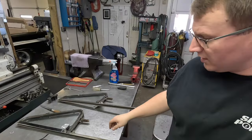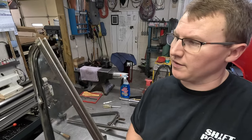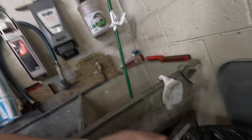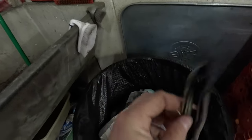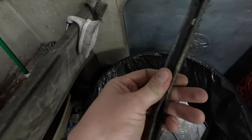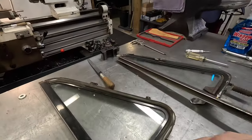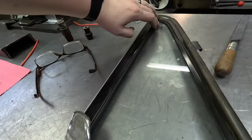We've got the vent windows over here. These channels had some felt weather stripping left in them — pretty sure that stuff's been there since '66. I got all that scraped out. This vent window has a two-piece seal: one side of the seal is here on the outside, and on the inside there's another one — that's where the window itself seals up. The first reason you do this is that the missing channel weather stripping lets the window just rattle around in there.